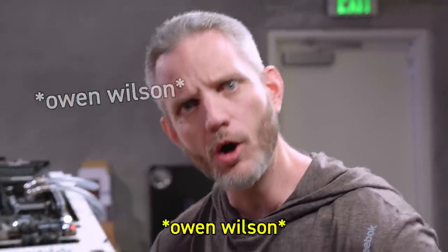Because we just spent the last three hours bringing all this out, we're going to go ahead and just make this a video, and then we'll go back to the original video we intended to do. Thanks for watching, guys — that was a 'simple' fix. It turns out the BIOS was probably not supplying enough voltage, which is funny because Phil's theory was that the overclocked CPU voltage doesn't help all the system agent voltage — like the PCIe voltage and VIN voltage for the CPU. Then he was in the middle of explaining why my single fix didn't make a difference, and then it booted. Probably none of this would have happened if it were a K and not a KS. KS — for 'Keeping it Stupid.' Thanks for watching, see you on Wednesday.